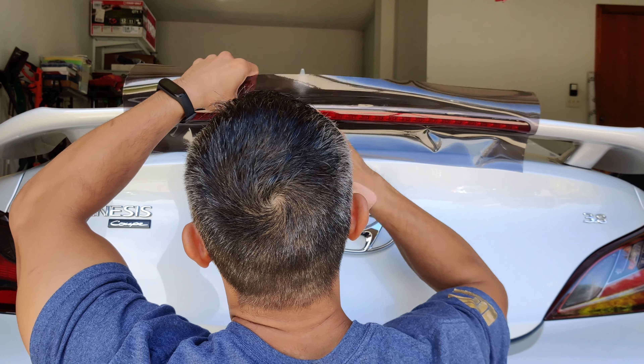The last thing I like to do is take my micro squeegee and go around all the edges to make sure everything is tucked in nice and tight and sealed down as well. Once you're done with that, this brake light has been fully wrapped. It's basically just laying the vinyl on, smoothing it down, applying it, tucking in the edges, and trimming it out. Hopefully you found this video informative, instructive, and helpful — if you did, please give it a thumbs up and hit that subscribe button.